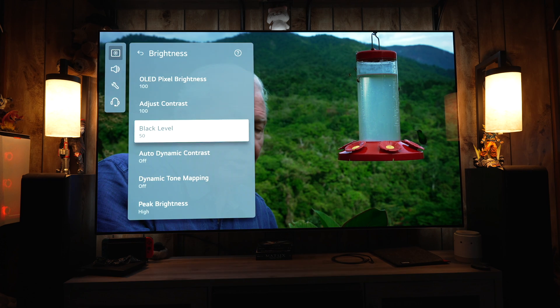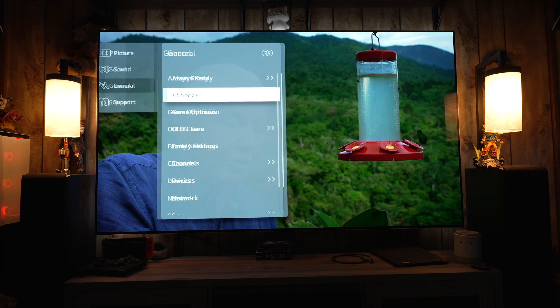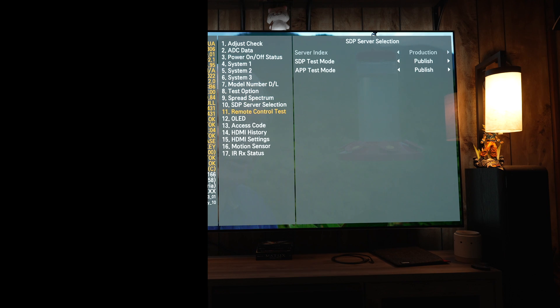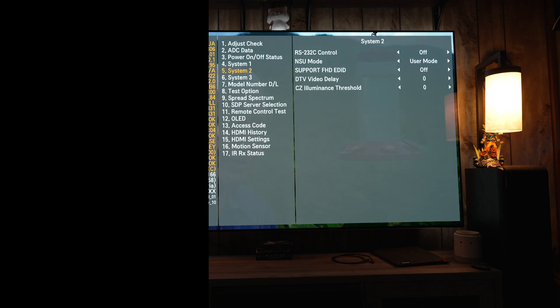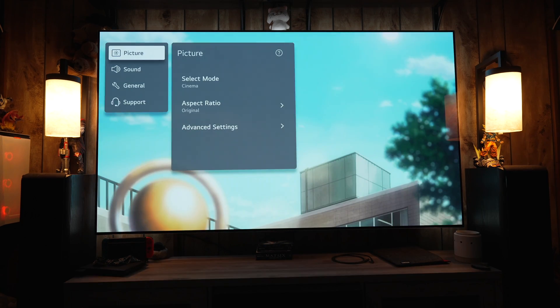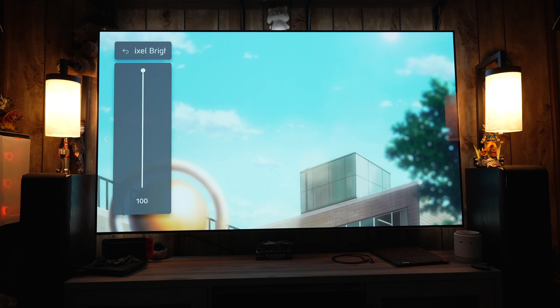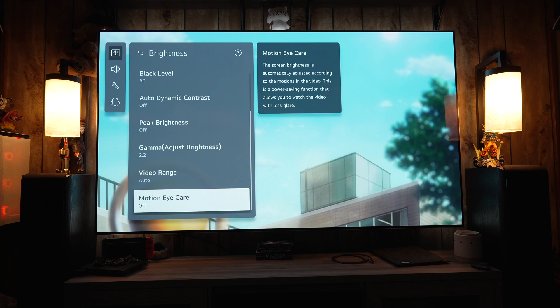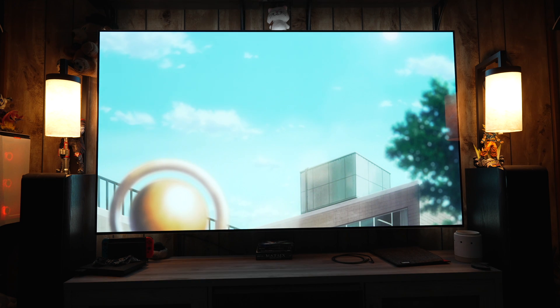The first issue with having this enabled: I'm showing something in HDR with none of the AI stuff on and it's at max brightness for HDR. Now I'm going to go in and turn Module HDR on, and you're going to see that in HDR, when you have this on, it actually makes the image darker. So in HDR content, you would want this to be on the normal setting. I'll go back in, put it back to normal, and the brightness goes back to normal. Making these changes back and forth has no effect or long-term issue with the TV as far as changing them quickly. I'm not saying long-term as in if you left it on all the time — then you may have issues with burn-in if you're playing games with it on all the time for a very long time. Whether or not LG looks at service menu access if you have to get anything done with the warranty, I don't know. Again, this is all at your own risk.